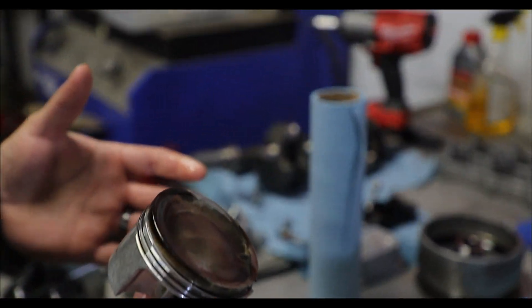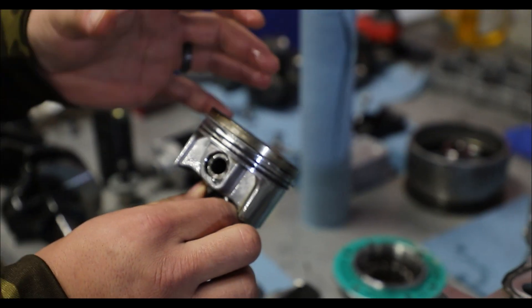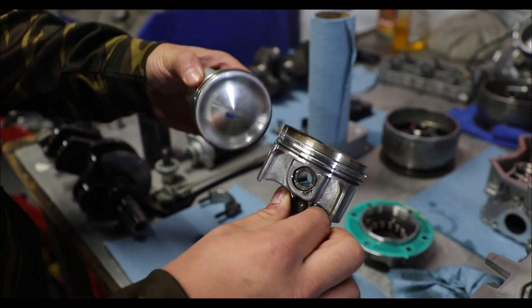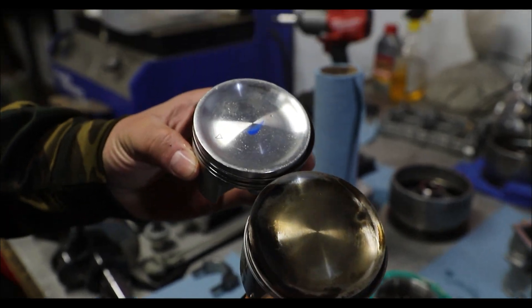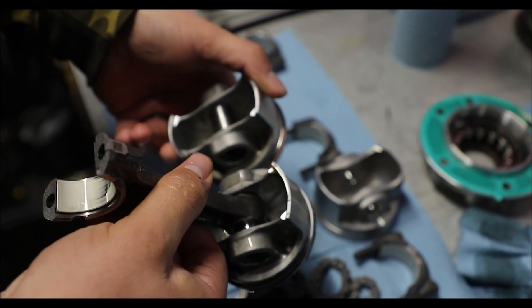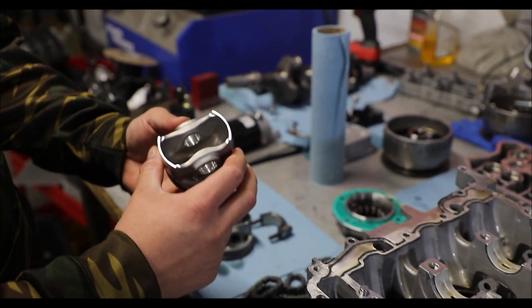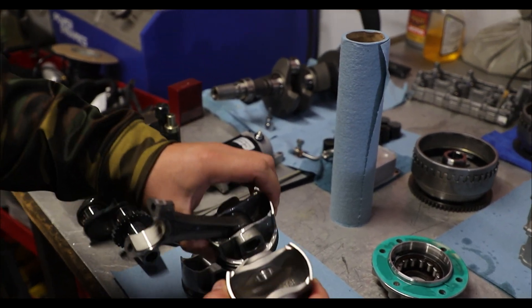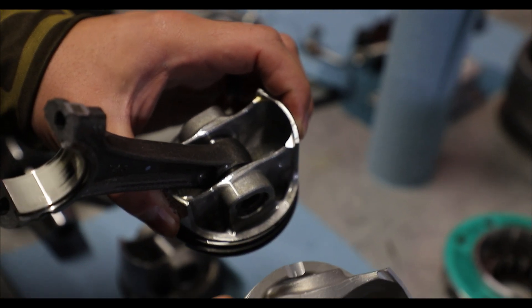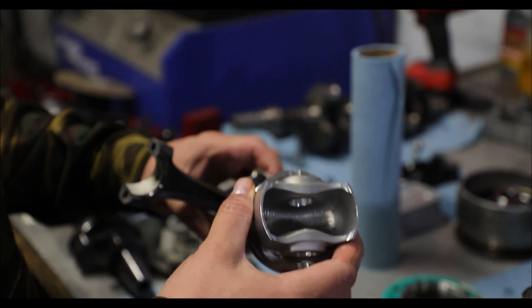You can see it's freshly machined off, but they did not do the RR piston, which kind of upsets me a little bit — especially for pump gas guys. This is the Mach Z piston and this is a brand new Can-Am X3 piston, and they are literally identical. The RR on the other hand is not — you can actually see it's a much better design piston.